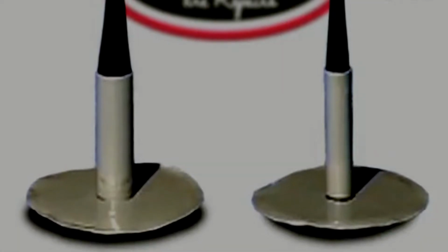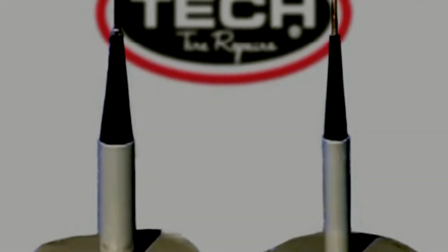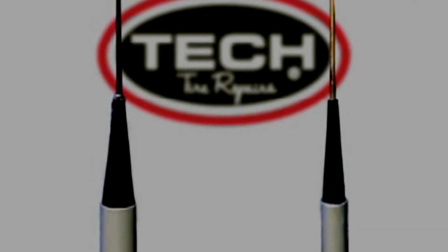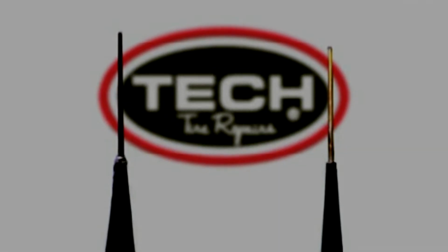The Uniseal Ultra stem and cap are covered with a gray cushion gum, which allows both stem and cap to vulcanize to the tire. In addition, a wire is manufactured into the stem of the 249W, 250UL, and 251UL to make installation of each repair unit much easier.